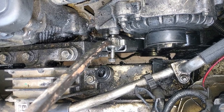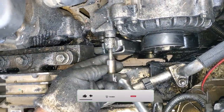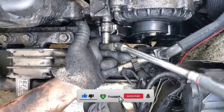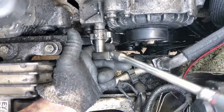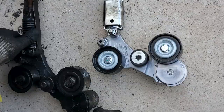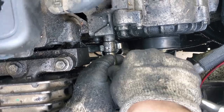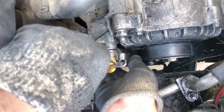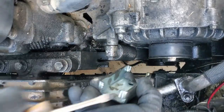This last bolt can get a little tricky. I was able to crank it over with my pry bar and get it on. If you cannot get it on, you'll need a 19mm socket and ratchet to crank on the assembly and swivel it so the bolt can line up. This is a small bolt so don't over-torque it or you will strip the threads. Once done, the last thing is to remove the little spring retainer, put your intake duct and air box back on, hook up the mass airflow sensor, and you're done.